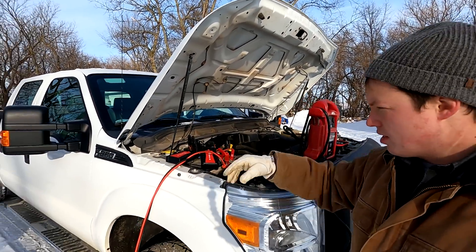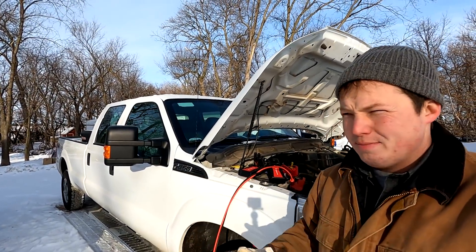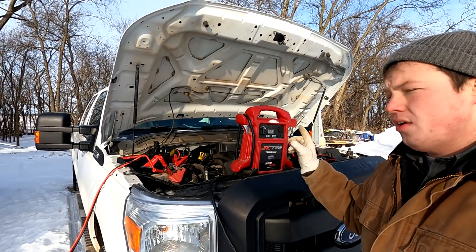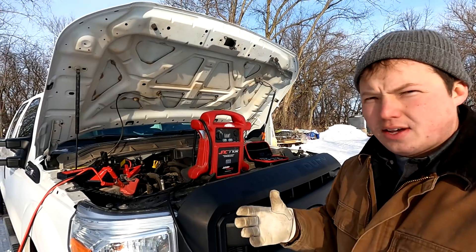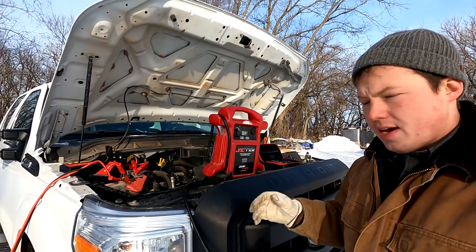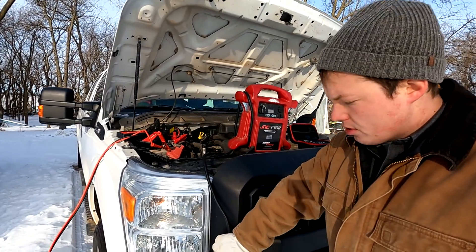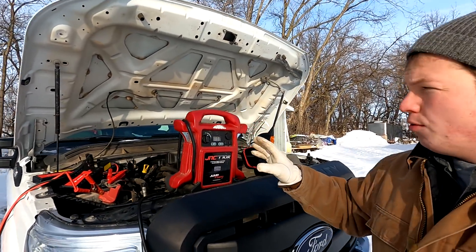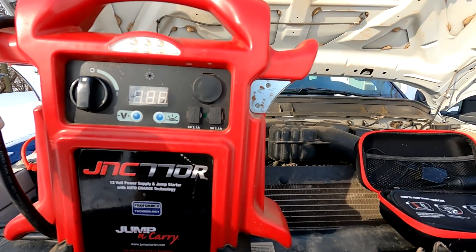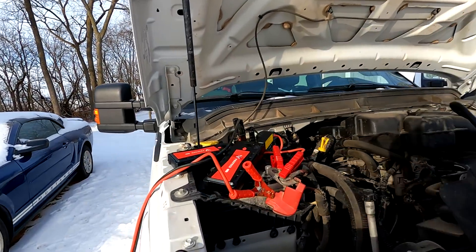My final takeaway is that both these lithium jumper packs and this large lead acid one have their place — they serve different purposes. The lithium ones will put you over the top in most situations, so having a couple in your car is not a bad idea. If you want something that can temporarily stand in as your car's battery, you'll want something like this lead acid unit. I also use it on lawnmowers without a battery, backhoes, and tractors that require serious cold cranking amps. It also has a disconnect switch so the cables don't accidentally short out, a 12-volt outlet, USB ports, and a light. I'll link to that and to the Fox Speed ones in the description.